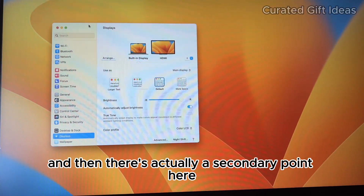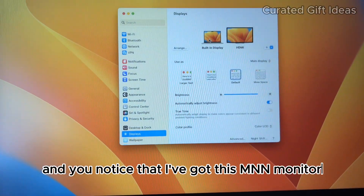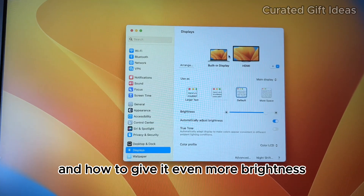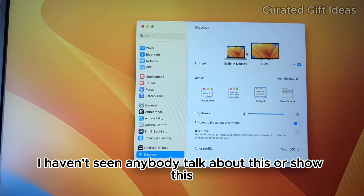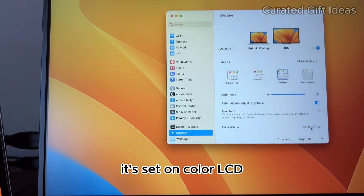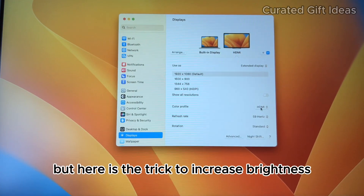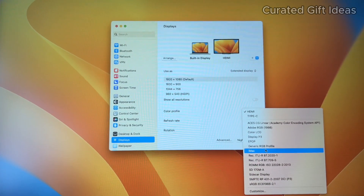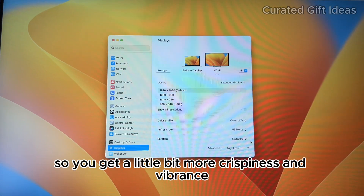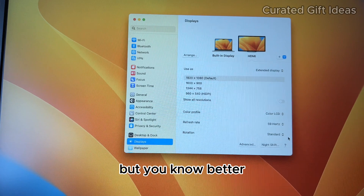There's also a secondary tip here. I dragged the general settings and went down to display options. You'll notice I've got this MNN portable monitor set to the right. To give it even more brightness — I haven't seen anybody talk about this — on the built-in display for the MacBook Air M2 it's set to color LCD. But if you go to the HDMI screen, it's set to HDMI. The trick to increase brightness is to change it to color LCD to match. You get a little bit more crispness and vibrance that way — just a small boost, but better. Definitely play around with that.